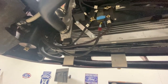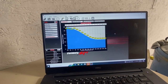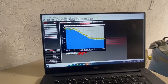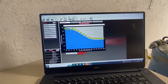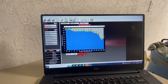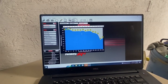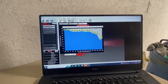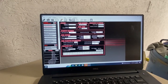Now we can get into actually messing with the fuel. To get this thing to start better, we're going to focus on a handful of things. First, go to your fuel ICF startup enrichment — that's one thing we're going to mess with. This is the old tune and it's way, way wrong. That's your cranking fuel. We're also going to mess with the IAC parked position. The other thing is this fuel pump prime percent — we'll be fiddling with that a little bit.